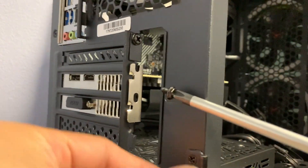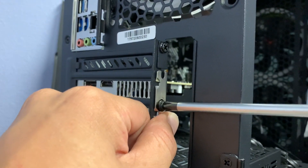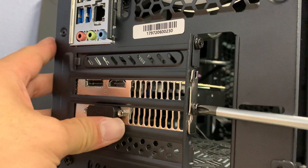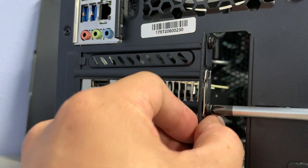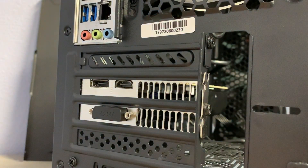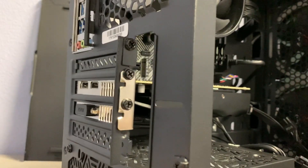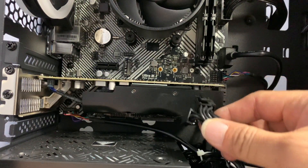Replace the two retaining screws. When tightening these, here's one tip: make sure this panel is not pushed too far up, because it may block your HDMI port. Just let it sit loose, then tighten it making sure the HDMI port is properly exposed so you have no issues plugging in your display cables. Two screws are installed. Depending on the card you get, you may have a power connector — just plug it back into where it was on the previous card.